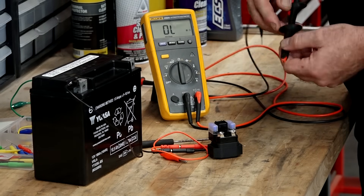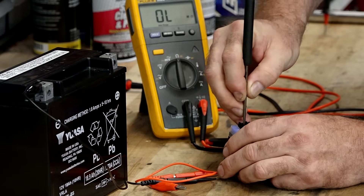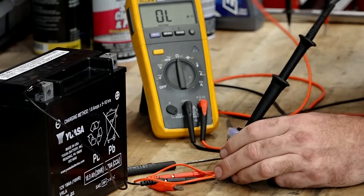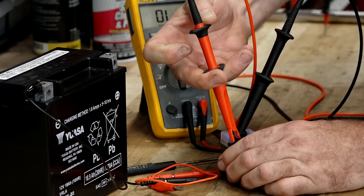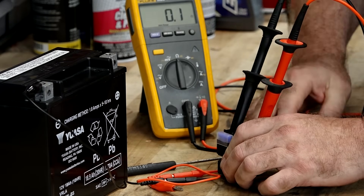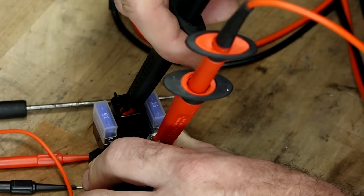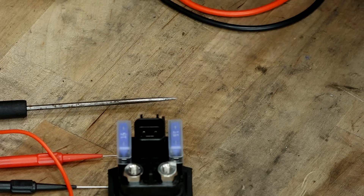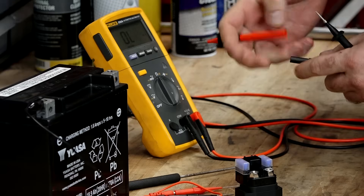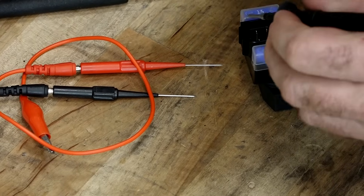Let me show you what I'm talking about. Let's find out which post this one up here goes to. You can actually see that it's connected together down at the bottom, so it's just one point. So on this particular relay, this post would be going to your battery, and this output would be going to your fuse box to be distributed through the rest of the vehicle. We want to verify that these other two are actually the coil. The way you do that is just take a resistance measurement across them, and it should be around four to five ohms, because that's typically how much resistance is going to be inside of a coil.